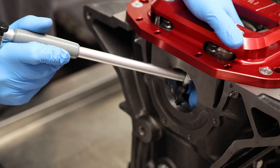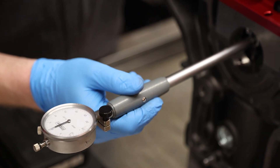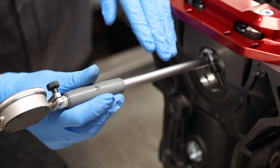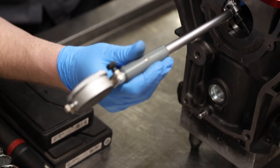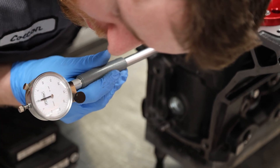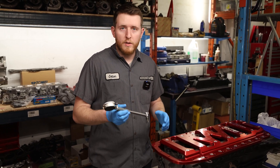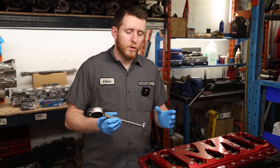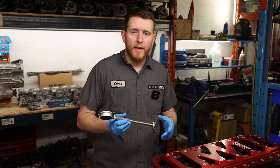Because the RB26 has an oil groove, we have to push up on the bore gauge and bring it back to the rear section and compare the measurement. Right now we are at two tenths taper, which is well within the allowable limit. We'll also check at about 45 degrees from vertical to check our out-of-round — we're about two tenths, which is allowable. There are a couple of specifications required: our margin of error is generally two ten-thousandths of an inch. Depending on the bearing manufacturer, usually allowed up to one thou out-of-round, and up to half thou out-of-line on the rods. For the main line, we're looking for less than two tenths taper and less than one thou out-of-round up to the parting line.